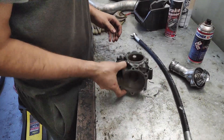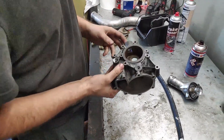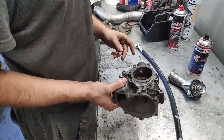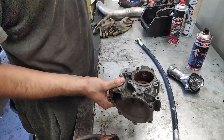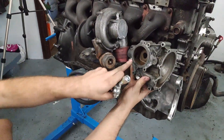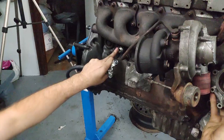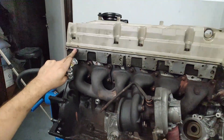This is a quick tutorial on how to do the OM606 cooling mod. The engine suffers from having a hot cylinder — number six cylinder from the backside. This mod gets coolant to the engine block. The basic idea: you have your thermostat and water pump housing, you drill a hole here and connect it with a hose, and that gets fresh water to the last cylinder which suffers from heat issues.